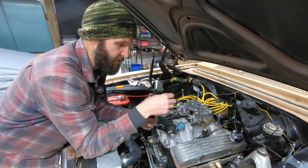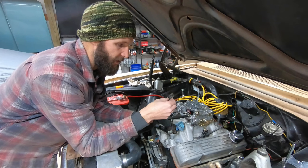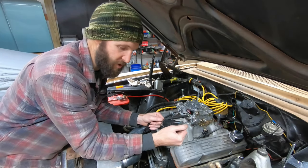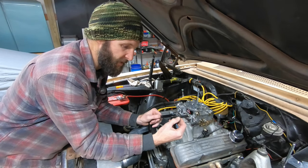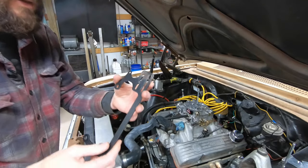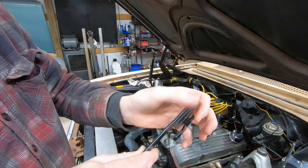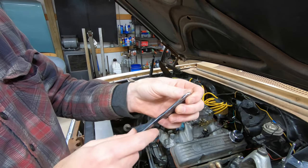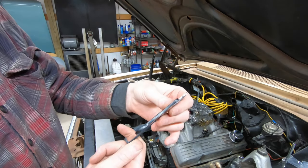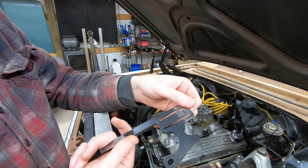This was a perfect opportunity to do something that was completely non-critical, make the bracket look a little more finished. As you saw, I do know how to use a grinder, and if you can't weld worth a shit, at least clean it up, right? So that's what I did. I cleaned it up a little bit, and you can see the penetration's there. That piece isn't going to come back off, even out at that outside edge. Now you can't even see where there was two pieces other than I didn't clean it up very square. So that side, you can see where it was. I didn't quite fill that all in.